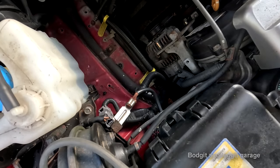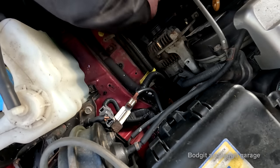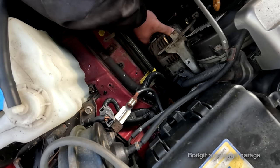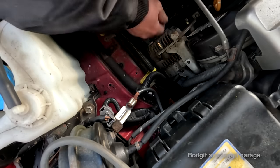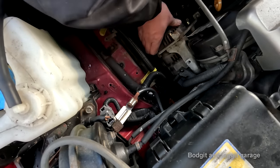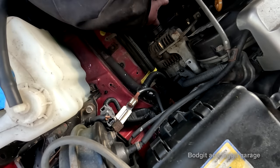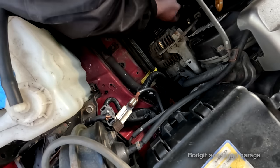I'm going to, off camera, try and get them three bolts in tight. This bottom bolt... actually, no, I can't do the bottom bolt because this needs to move as I'm tightening it. So I can tighten these three bolts and I can tighten this one because that doesn't have to move. And then once we get the correct tension, then we can tighten the bottom one, because otherwise we're just fighting against the bottom bolt. It's not going to be very good.